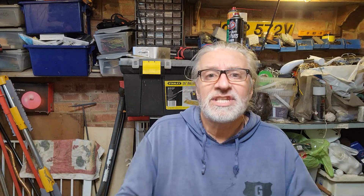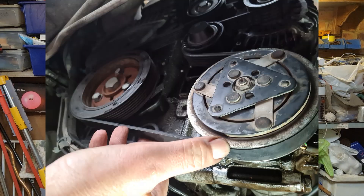It was a bit of a cock-up on my part. It was the AC pump. When you get closer with the wheel arch liner off — because I had to take the wheel off and the wheel arch liner off so I could get the auxiliary belt back on — don't believe the videos, you have to take the wheel arch liner off, get up there with the tensioner, wrap it around all the pulleys. And it was when I was listening that I thought: that's coming from the AC pump, not the power steering pump.